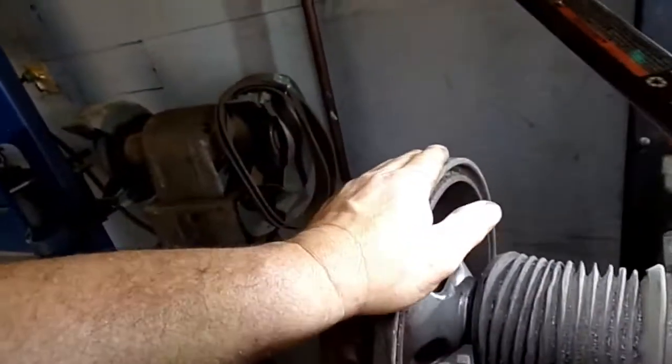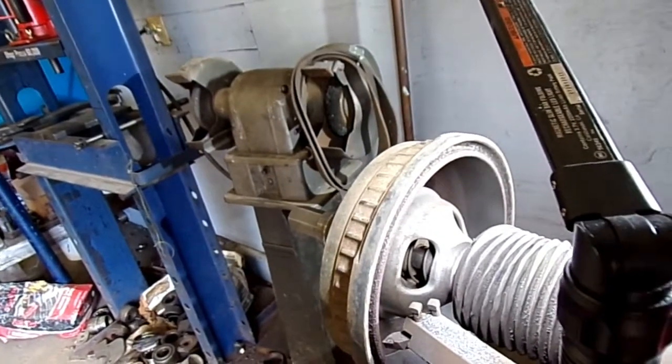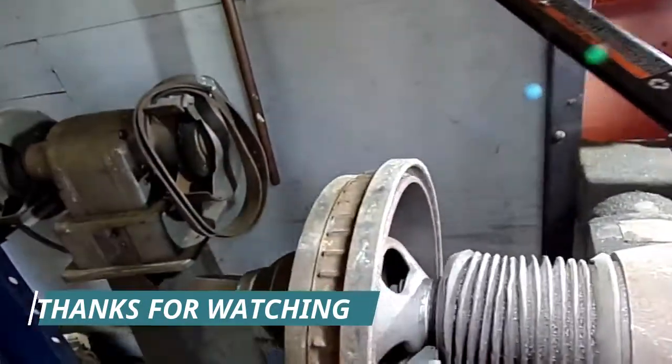You don't know how much that would help you on your rear brakes if you're putting rear brake shoes on — just getting them smooth so your entire rear brake shoe will contact the drum when you hit the brake. It'll eliminate any squeaky noises you'll probably get if you don't do this. I've done I don't know how many drum brakes, and when somebody wants it done cheap and just wants brake shoes with nothing else, you can hear a squeak or squeal noise coming from it. We're not doing that.